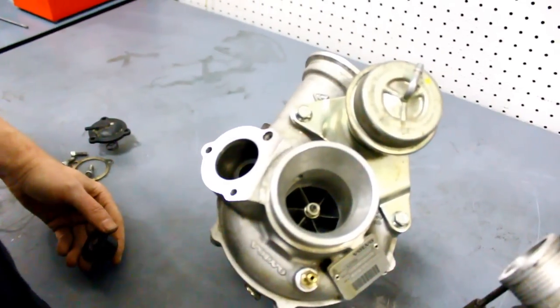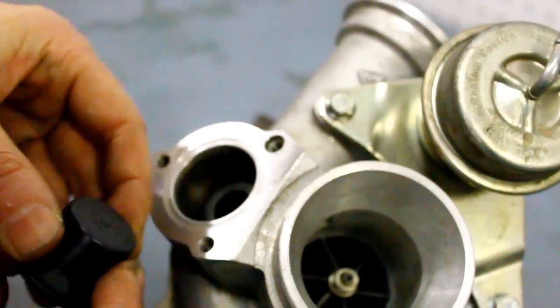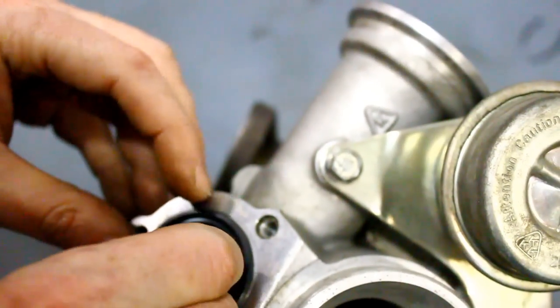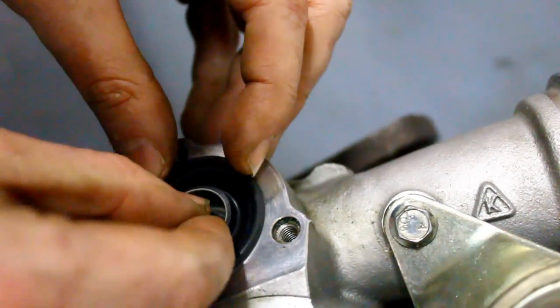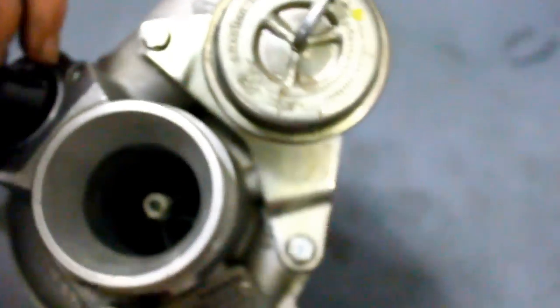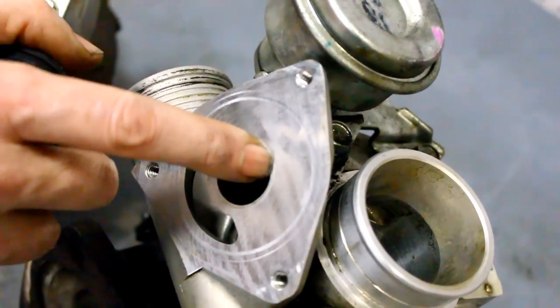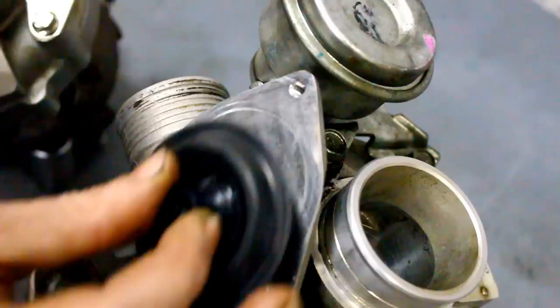Here are some of the obvious inefficiencies. This flat face of the Triple K piston is not actually indexed in any way, and even though there is a spring pressing down on it, it still has the ability to flex around and move side to side, which can cause it to leak. Same thing is true on the Mitsubishi turbo — this flat face is not really indexed, and you can see in the wear line that it wasn't even resting centered around the center hole, so it can move around and it's going to leak when it does.